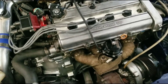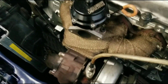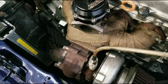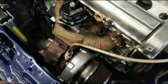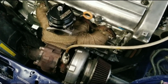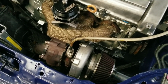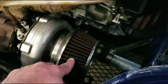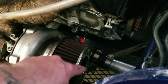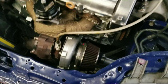In the engine bay, a couple things stick out right away — there's no dump tube. With the hood open it's gonna be shooting hot exhaust gas around, but when the hood is closed you're gonna be shooting hot exhaust gas inside the engine bay, which is gonna spike your intake air temps. There are turbo inlets right there too. It looks like it's got a cheaper filter — I'm going to take this off for the dyno because some cheaper filters have a chrome piece on the inside that's glued on, and they've been known to come off and get sucked into the turbo.